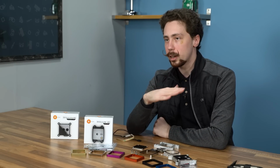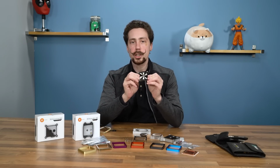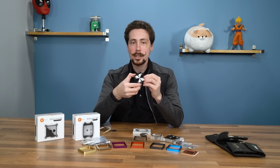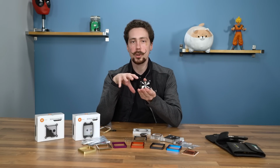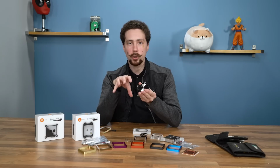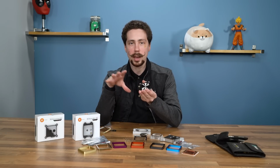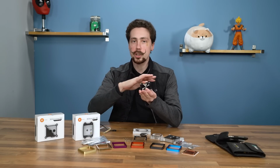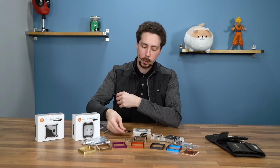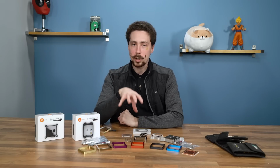They're quite often a little bit concave. So you want to have a convex shape on here to be able to match up with that and get the best possible contact. Other manufacturers are also doing this as well. Sometimes you can either use just a jet plate or something to move the copper, because obviously this is quite thin. So if you put enough pressure on it, it will change the shape of it. And other companies such as Optimus are using their high-end CNC machining in a very similar way to get a perfectly polished but convex shape on the bottom of their plates as well. The idea being that having ultimate contact with the CPU should mean that thermal transfer will be higher.